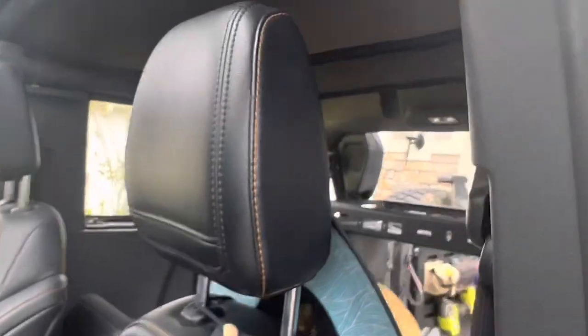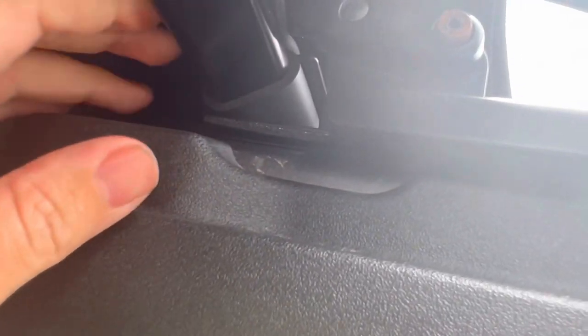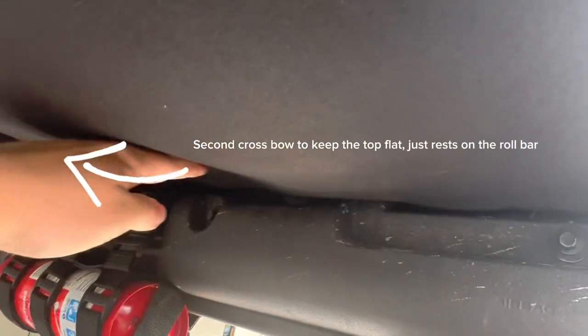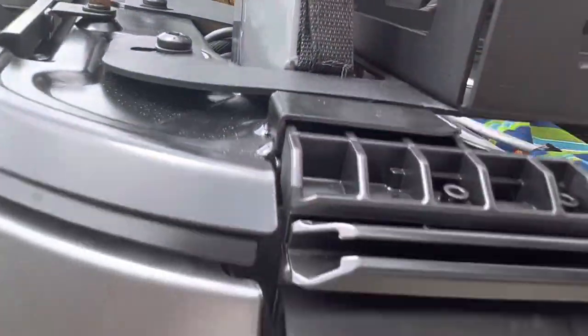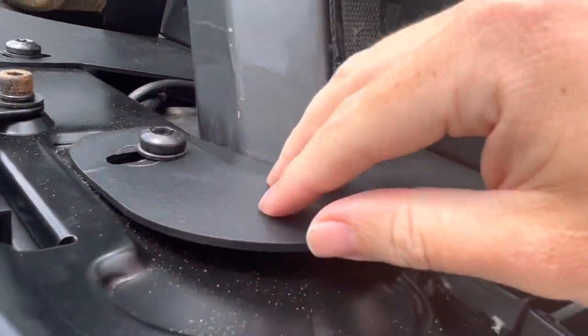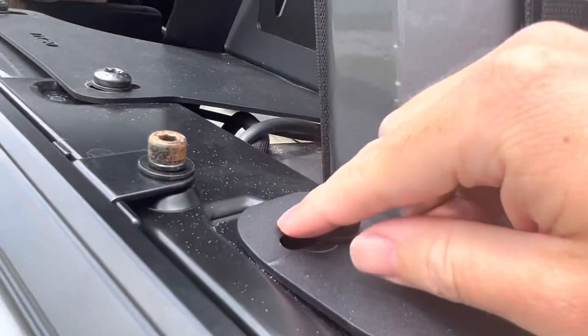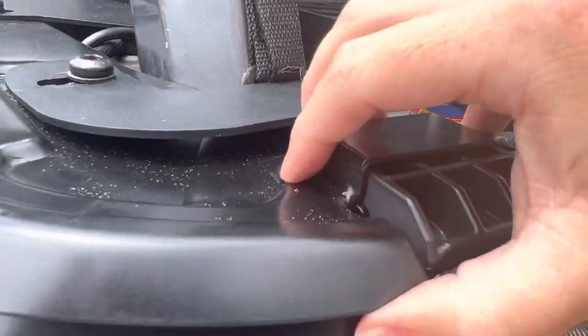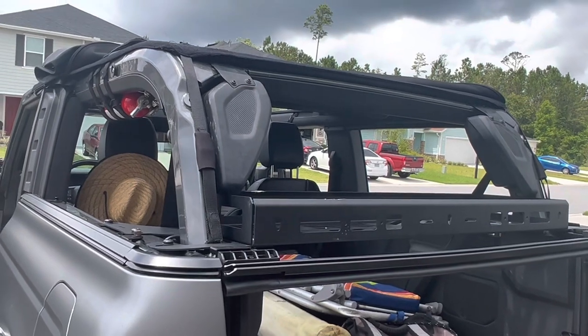Underneath there are these crossbars right here. The bracket that goes along the top right here has a hook — the crossbar just slides into the hook right there. So it's not too difficult to remove. Once you take the top off you can slide that out. It's not secured to the side back there. Come back here — the strap right here has a hook. You'd undo this plate right here. You loosen this plate with this bolt, then you can kind of pick it up a little bit, undo the hook, and do all that on the other side. That's how you remove the entire top — super simple, maybe takes a couple of minutes if you want that whole open air experience.